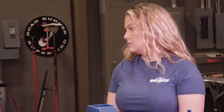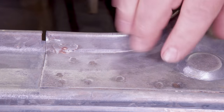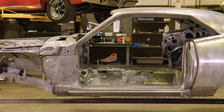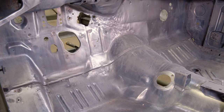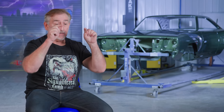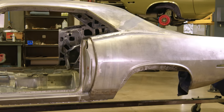First we want to make sure the body panel I'm about to talk about started life on this shell. We've established that the shell itself is a Grand Coupe. Here's the rear body panel — here's the trunk gutter, which welds to the quarters, which makes up the shell. Do those spot welds all look pretty original and unmanipulated? Yes. We know the front frame rails were factory welded to the floor in this car, and those are welded to the rockers. The core support is off of another car, and it would appear that the firewall is off of another car — both of those items happen to have the hidden body numbers in them.